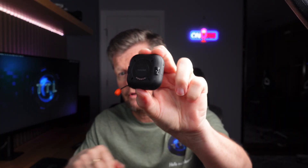Battery performance is especially important with a camera like the GO Ultra because it does not have user-replaceable batteries. When you run out of juice you cannot simply swap out the battery and keep going — you have to put it on charge and wait. So you want that runtime to be as long as possible and charging as quick as possible. The camera also does not have a USB port. The only way to charge it is by the contacts on the back of the camera, and currently the only compatible device for charging is the GO Ultra Action Pod. The Action Pod has its own built-in battery with about enough capacity to charge the camera two times, or you can plug the Action Pod in through its USB port to charge both the camera and the Action Pod, and it will prioritize charging the camera first.